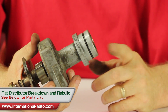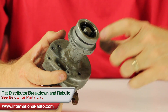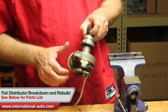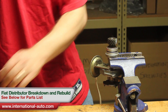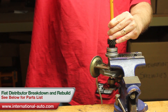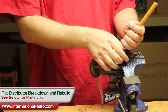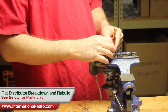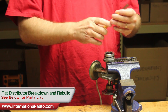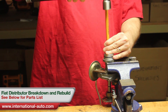We've got the gear off. Now I'm going to show you how to take the shaft itself out. Sit the base of the distributor in the vise and take a punch to drive it out. Make sure you remove the counterweights from the distributor plate on the top, because otherwise they're just going to pop everywhere. Drive it out a little ways and the gear should come right off. There's your gear, and then you're going to have a washer — there will be another washer in the distributor also. The thicker one goes down towards the gear.